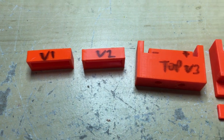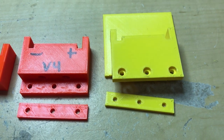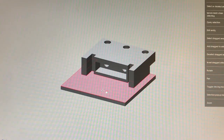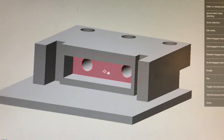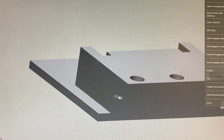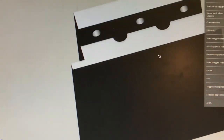Designing the plug for this battery is an iterative process. It took me five tries until I got it the way I liked it. Here's the connector I designed to go into the RadPower battery. This plate is to make sure you get the polarity right and it slides in the back of the battery. In here are where the two pins for plus and minus will go, and it slides in. In the back I've made three machine bolts that will hold a clamp to keep the wires from slipping out.